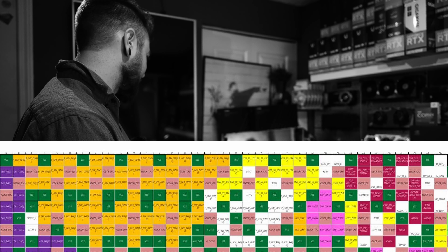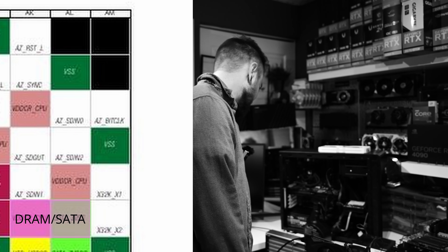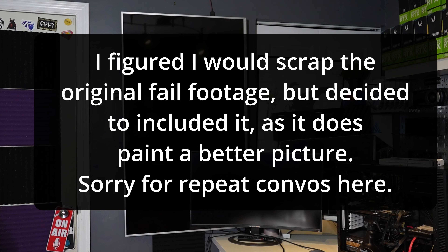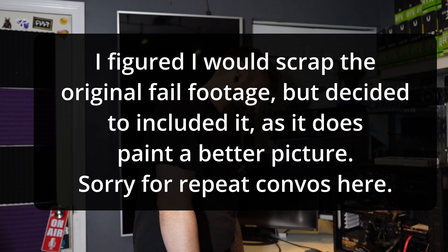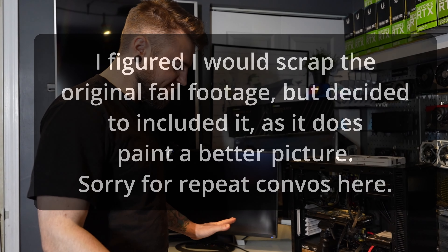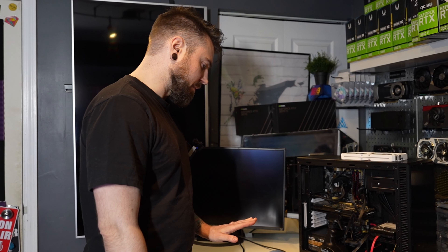Fortunately it's only for a voltage thing, but we'll find out later that's kind of terrible too because it's actually connected to the DRAM. One is a SATA one and the other has to do with DRAM. Anyway, I took out the CPU, found that tiny bridge, and I also updated the BIOS. So we're going to try to see if it posts this time.